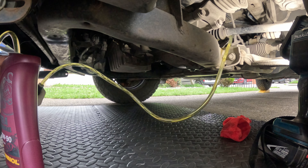We're getting nearly there. Now you can see it's perfect — oil has started to come out of here; it's dripping out. That means our gearbox is full of oil. Our oil is just starting to drip out of that filler hole — this is exactly what we want to see.